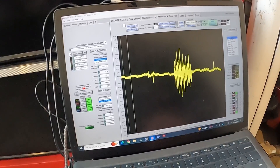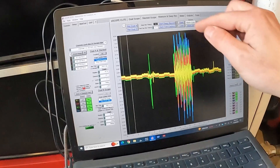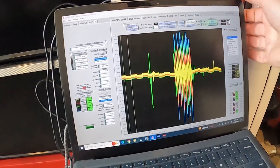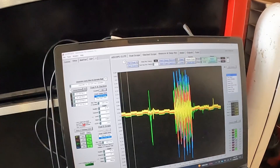We can rule out yellow as being our noise. Red and green are kind of similar, so we might move those around to different spots close to their location and get another reading. But blue is definitely the loudest. Blue is hooked up to our number four slot in the back — we'll see what color that is. That is white. There's a white little tag on it and white tape on the other end.